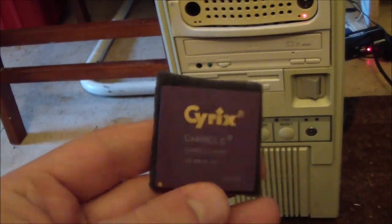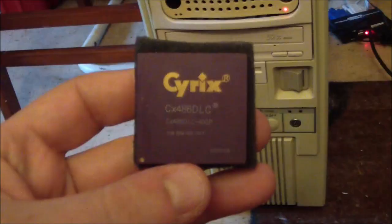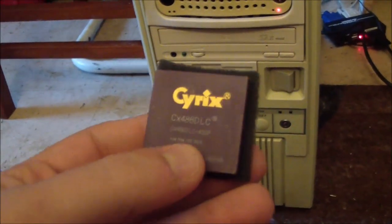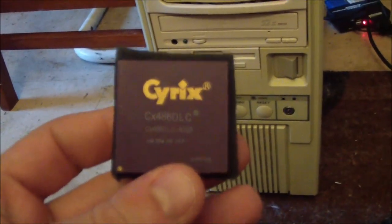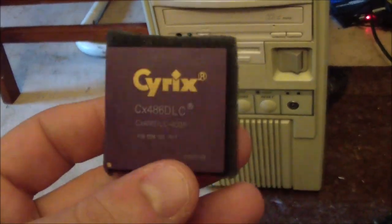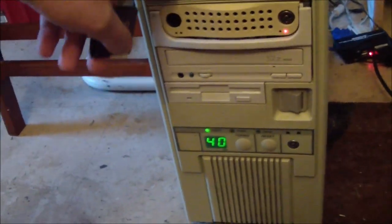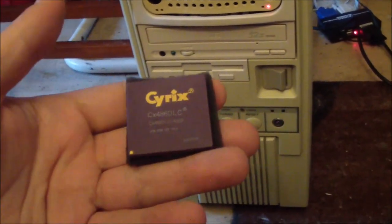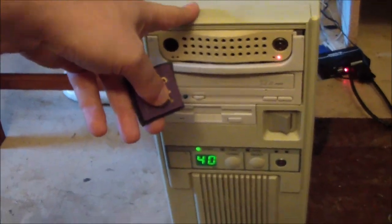There's also slower versions of this chip - a 33 MHz version that is quite a bit more common than this 40 MHz chip. This chip should be compatible with most 386 motherboards. For the L1 cache, it doesn't automatically activate. You either have to use software to activate it, or some motherboards have it built into BIOS where you can enable internal cache.